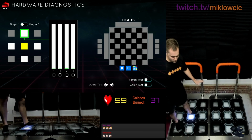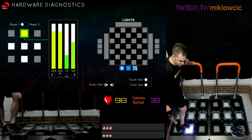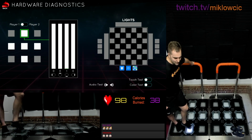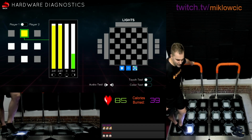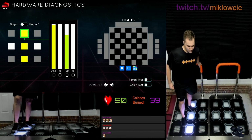You might also see an issue where when you press down on the sensor, they might not be releasing as fast, like going back down to 0 as fast as you would like. That can lead to held misses. Also, you might see resting pressure on some sensors. Especially if you don't have the corner grommets, you might see non-zero values here, like values of between 3 and 100 even, of resting pressure on a given sensor.